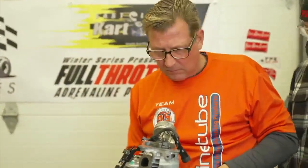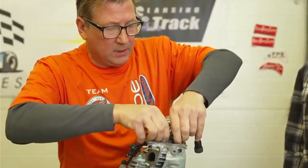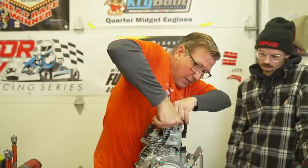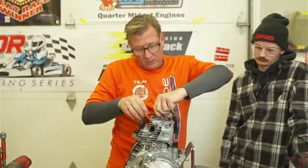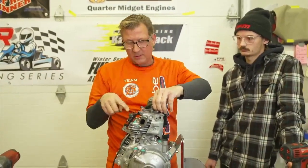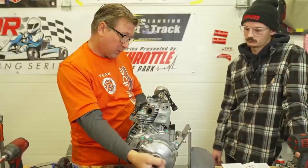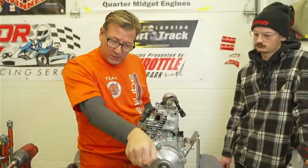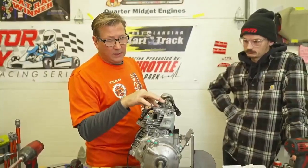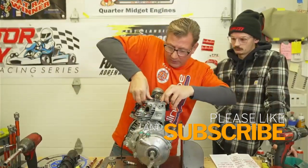TDC confirmed. Somebody asked: should you be at top dead center? Yes, we should be at top dead center. The problem is with these little motors, 100 PSI in your automobile has to spin eight cylinders, but 100 PSI in here is spinning this little engine. Without something on the gearbox holding the crank at top dead center, it's always going to spin to the bottom. But that's fine - we took the pressure off the valves by removing the rocker arms, so it's like being at top dead center. It doesn't matter as long as you know the valves are sealing.